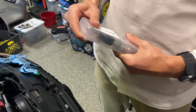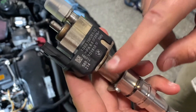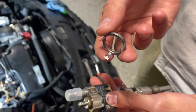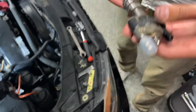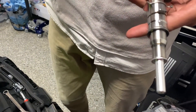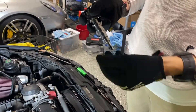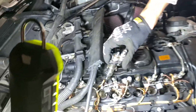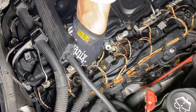We have our new fuel injectors. Take note of the two three-digit values on each injector — these are the values you'll input into Pro Tools or whatever software you're using. Next, attach the decoupler — the FCP kit comes with six of these. Just clip it into place and it'll spin on. Once you remove the tip, you only have five to ten minutes to put the fuel injector into the engine, so be somewhat quick. Rotate the tip off with your fingers — don't use a tool. With the tab facing forward, press it down into the hole until it stops moving.